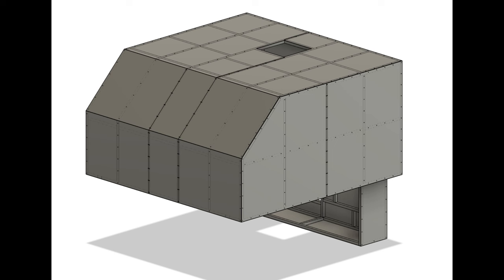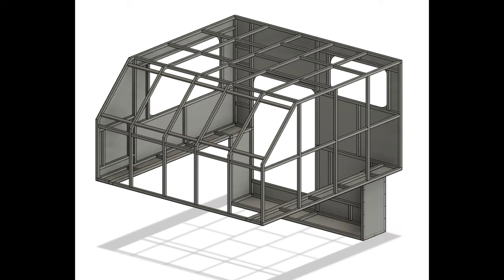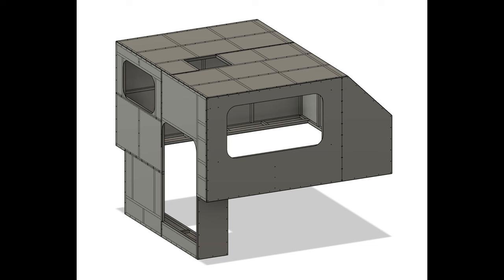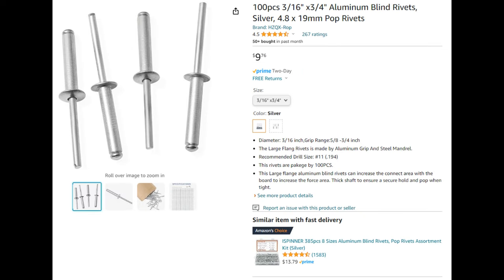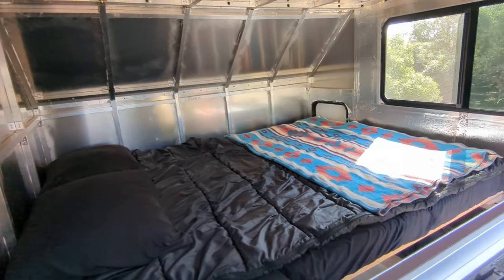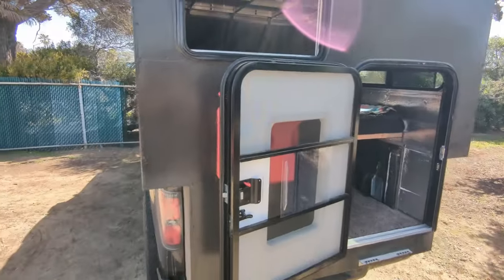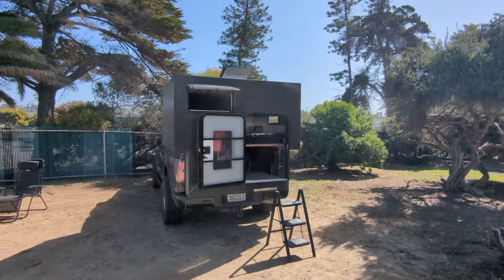The structure is all aluminum square tubing that is riveted together using angled brackets. I had aluminum sheet laser cut to my exact design and riveted it onto the subframe. To do this I used SikaFlex 221 and aluminum rivets. SikaFlex 221 is a marine-grade adhesive perfect for this application as it stays permanently flexible and does not get rigid. The end result is a very tight, strong camper — when you bind the outer sheet metal to the inner frame, the structure becomes very stout.